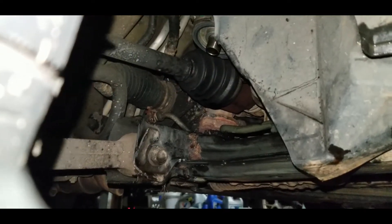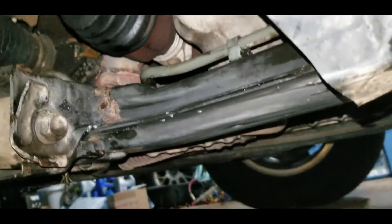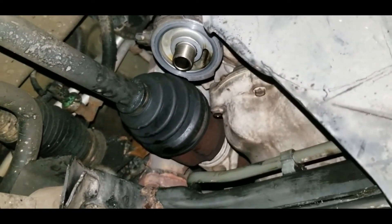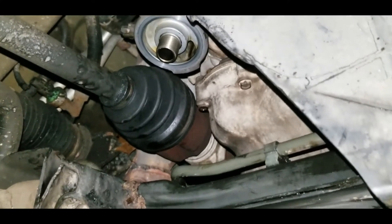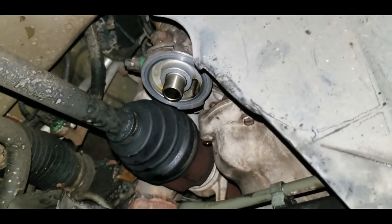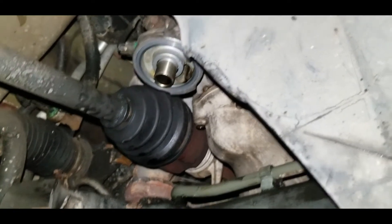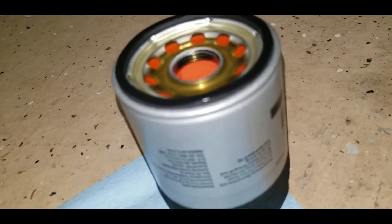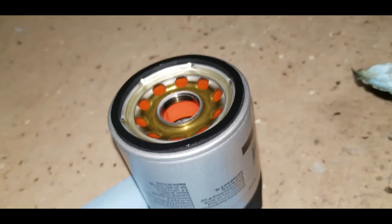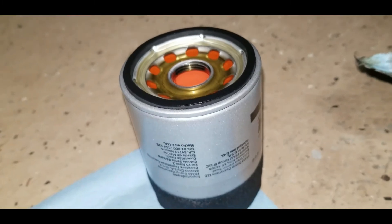We got the oil filter off. Clean everything up and wipe off any excess oil. Spin the new oil filter back on — the object is to get it on there snug but don't over-tighten it to where it's a pain to get off again. Once the gasket surface makes contact, about three-quarters of a turn more and that's it. I like to pre-fill these filters because they are vertical. Take a little fresh engine oil and lubricate that o-ring on the filter assembly, then get it screwed back on.